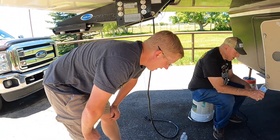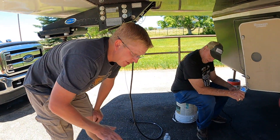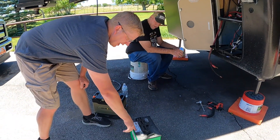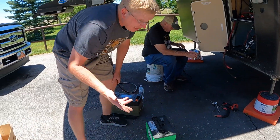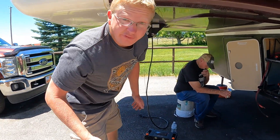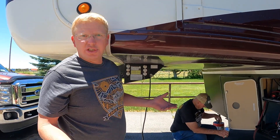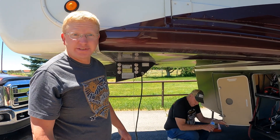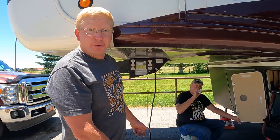That's a pretty good savings when you factor in two batteries. But also with these old lead acids, they are 20 amp hours, so between the two he had 40 amp hours of battery. Now with two of these we're going to have 100 amp hours each, which is 200 amp hours of battery. That's a huge upgrade — losing weight, five times as long-lasting power. I don't know how you go wrong, especially with the cost of these batteries.